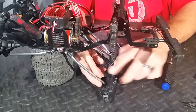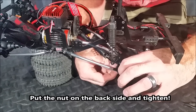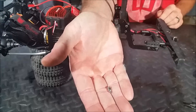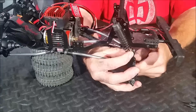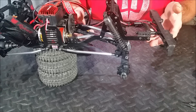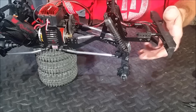The next step is to put your lower links on — use the lower hole. Once this lower link is installed, do the same thing on the other side. Next, pop these ball mounts out of the lower shock eyes. Once you pop those out, the shocks can mount right to those ball studs in the axle. Once those are on, your rear end installation is complete. Make sure everything flexes and works well — you can see that there's plenty of room between these components because of our lower mount relocation.